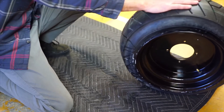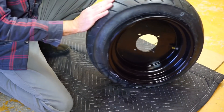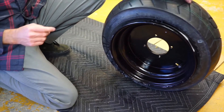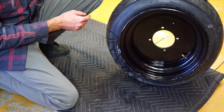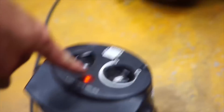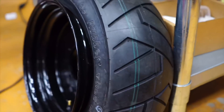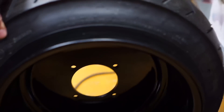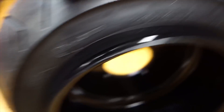When you know you have a ton of pressure in there, you can just let it sit outside in the sun or near a little heater — it'll pop eventually. You don't want to put tons of pressure in there. Here's a little report: the heater on the tire. It's almost beaded, you can see. Just a little bit more to go. The other side still has a long ways to go — I don't have the heater over on that side yet.